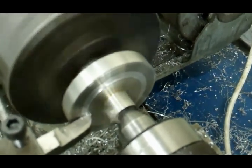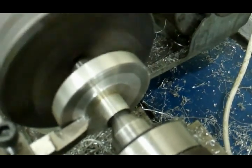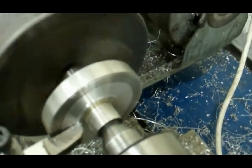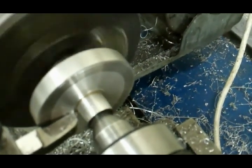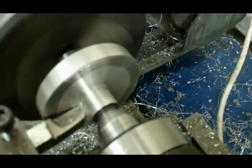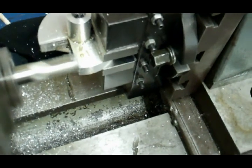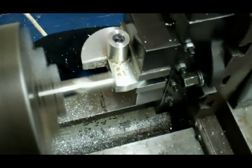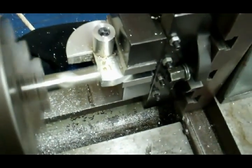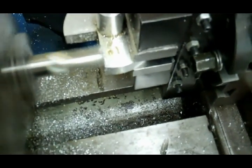There are two ways of going about getting your swinging arm to fit the frame: you can engineer the swinging arm down, or you can cut the frame out. This is what I'm making here — a special little tool which is going to cut the frame mounting lugs down. I'm just facing off this part of the tool. This is what I'm going to use to turn in the frame. We're just going to mill down some slots to mount on this surface area.